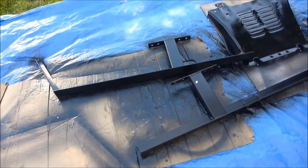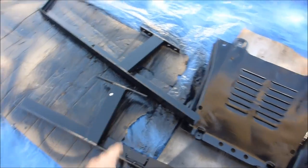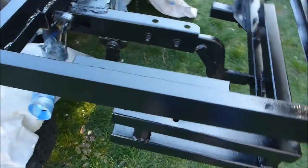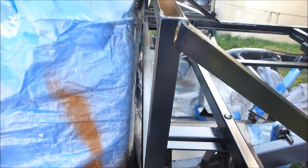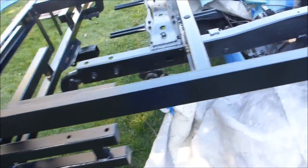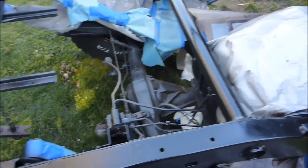After the paint-out — sprayed for about three hours today and everything's in gloss black. It's the under panel on the front, the running boards, the spare tire, and the front grille done in gloss black. The bed came out all right — no glaring drips in obvious places. I chose gloss black because it's really common; you can pretty much buy a can of gloss black spray paint anywhere if you want to touch it up. Went over it fairly thorough, got a few coats in a lot of areas, and touched up the frame cross members.